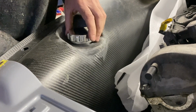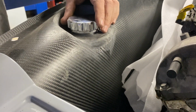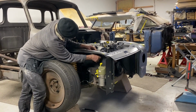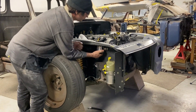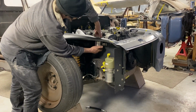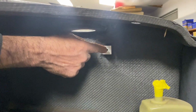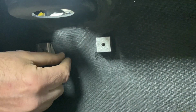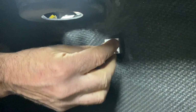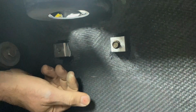We didn't want manky bolts or any fastenings coming through this firewall because we just want the thing to be perfectly smooth and clean. And so what we've done, if you come around this side, put the bolts in, take them out. Yep. We just glued on some aluminium blocks with a threaded insert effectively, and we're going to put epoxy glue around the outside of these and then put a carbon fibre patch over the top of them to hold them in place. And so that allows the fastener to be put in. Obviously we're going to use nice new fasteners, and it won't come through the other side, so hopefully it'll be pretty cool.